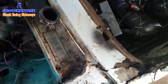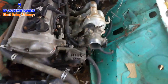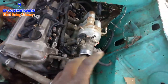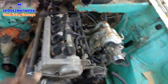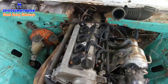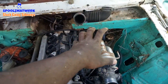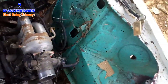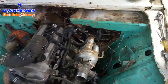I have the 1NZ flange, and I tack-welded the intake manifold onto it. I did a little fab work to close it up so there are no vacuum leaks. I'm building the adapter to get it all set together. When the body man starts working on the car, I want him to close off this area entirely to stop heat from coming inside the cabin, so I'm sorting out that part now — closing off all the open space.